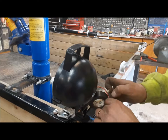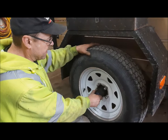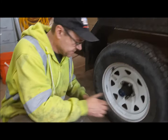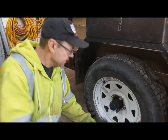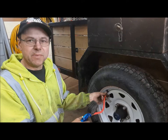Now we're going to check our wheel bearings and shoot a little grease in them. You just don't want to feel a whole bunch of play — they turn nice. This has got bearing buddies on it, so we just pull the plastic cover off and pump a little bit of grease in. Now we'll go ahead and check the tire pressure. They're load range C, so they should be at 50 PSI for max load. This one's at 38. That's max load — if you're just hauling the trailer around empty, you can let them down to 24 if you want. The trailer will ride a lot nicer, but I know better than to trust myself that much.